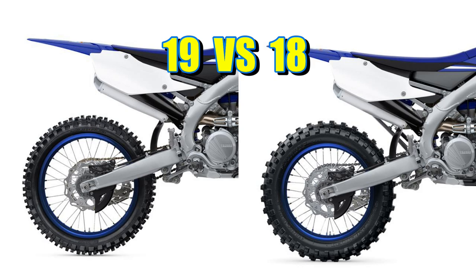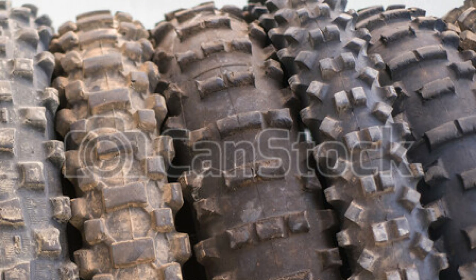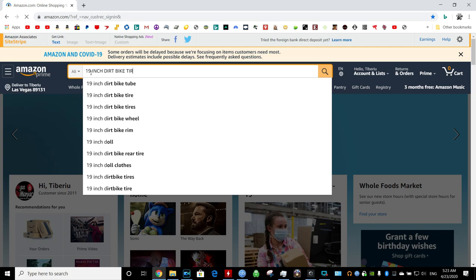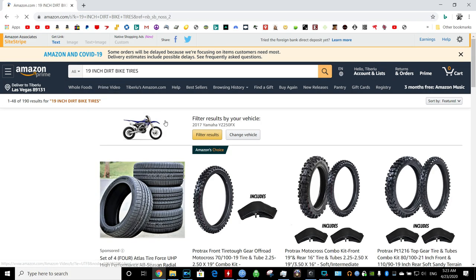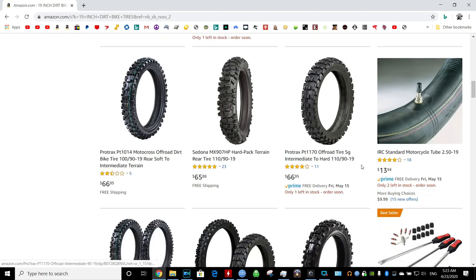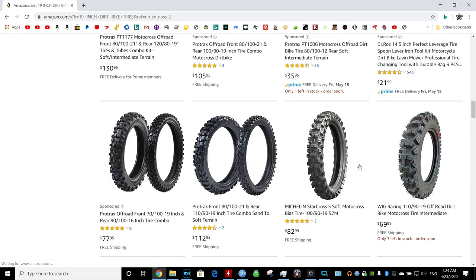What's the point? Why is a 19 better, or an 18 better than a 19? The answer is very simple and complicated at the same time. Tire choice is important when you choose your rim. On 19-inch rims, you are limited on the tire types that you could put on — there are less models available, usually just a couple of motocross and some trail tires.